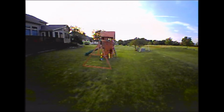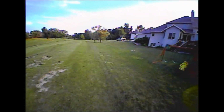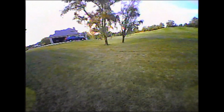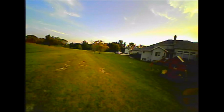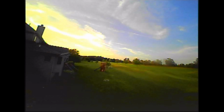All right. So I think, no, I haven't quite worn out. Part of it is Betaflight beeping at me because the defaults are generally too conservative. The battery's not really dead, but that is nice because that's all you get since there's no telemetry. There's a full punch out. Yep, there it says, hey, I'm done. But I don't have any of the problems that I had with the 110 GT. So let's level this out. I'm gonna check the battery. Okay, this is the 450 milliamp 80C battery. And punch out, you know, I can tell a little bit of a difference on the punch out, but whoa, geez, a lot of wobble.